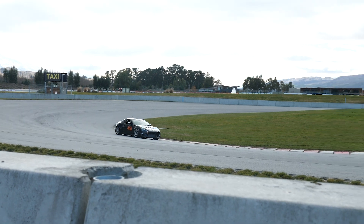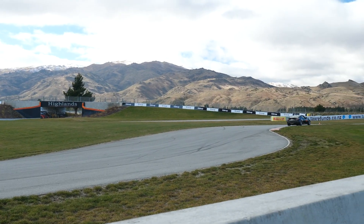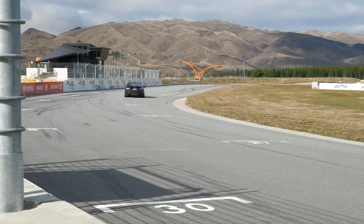On the other hand, when we take that car, start modifying it, start pounding it around a racetrack and pulling maybe in excess of 1.3, 1.4 g in corners and under braking, all of a sudden the wet sump system doesn't work so well. What happens is that the oil ends up sloshing away from the oil pickup under hard acceleration, lateral g, or braking, and then the oil pickup is going to draw in air instead of oil. This can very quickly result in metal-to-metal contact between the bearing surfaces and the crankshaft journals, and quickly results in destruction to your engine.